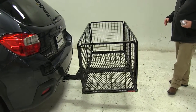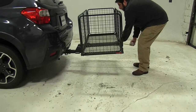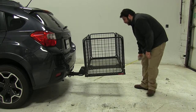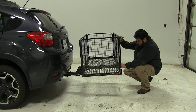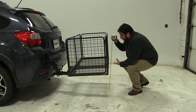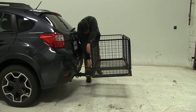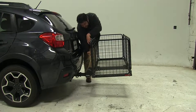I'm going to give you some measurements now, measuring from the bumper to our edge here — it's going to be about 37 inches that we've added to the rear of the vehicle. From our edge here, our ground clearance is going to be about 17.5 inches. And our closest point, which looks to be this portion here, again from the bumper, is going to be about 5.5 inches.